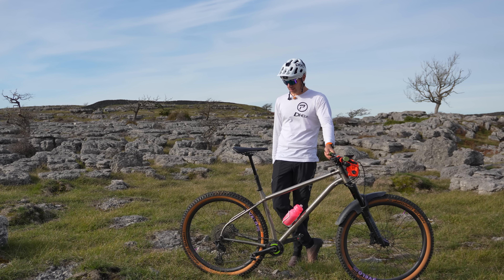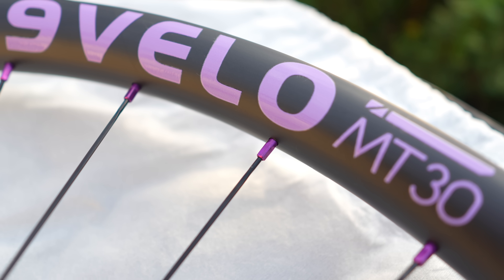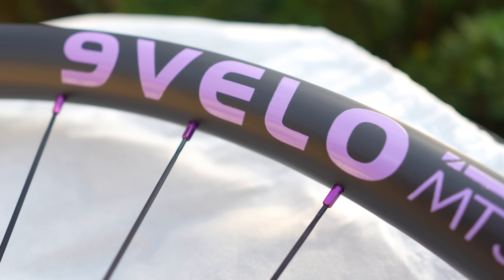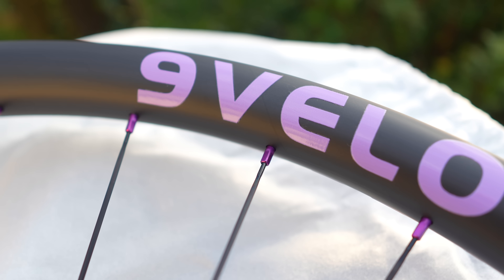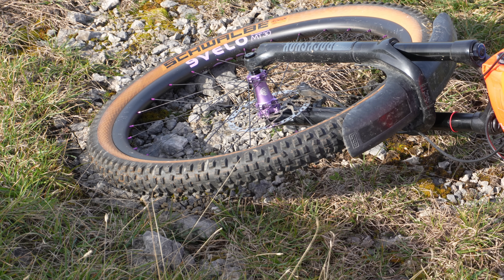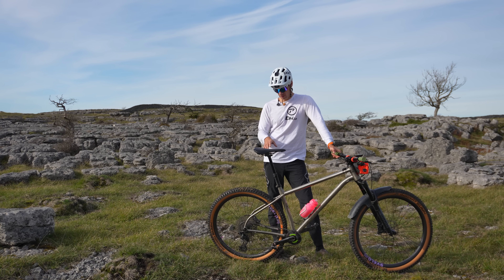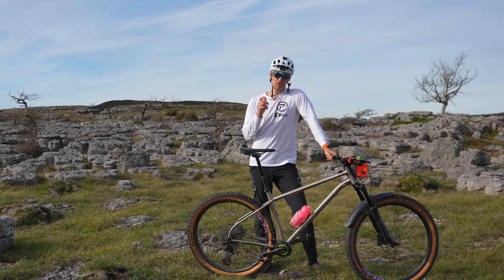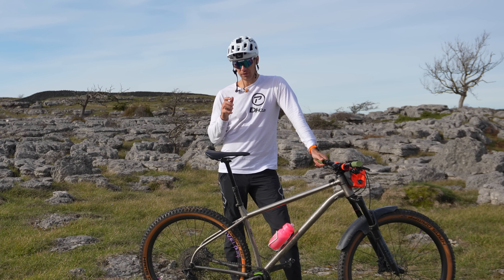CX Ray spokes basically never break — they're light, super strong, with the highest fatigue life of any spoke in the world, and all my favorite wheels are built with Sapim CX Ray. The nipples, although quite bling because they're anodized aluminium, I would prefer to see brass nipples for a bike that's going to be ridden all through winter and summer without much washing. Even anodized aluminium nipples do tend to corrode a little bit. These are the Sapim Secure-Lock anodized aluminium nipples — a very high grade nipple — but brass is a bit better when you're truing after a long harsh winter, as they don't seize or corrode as much.